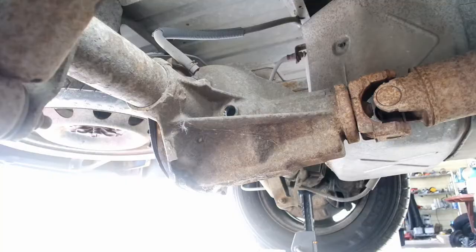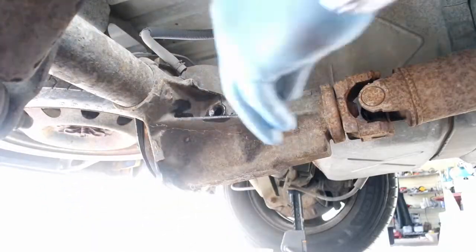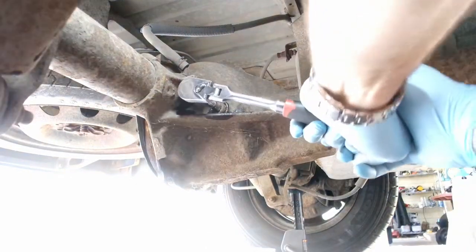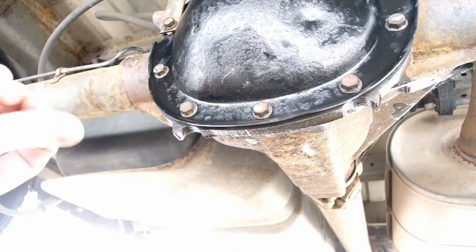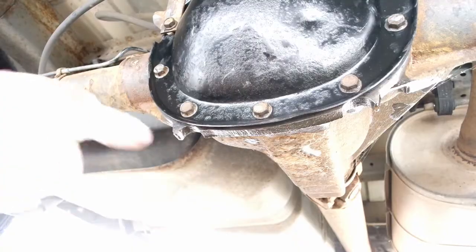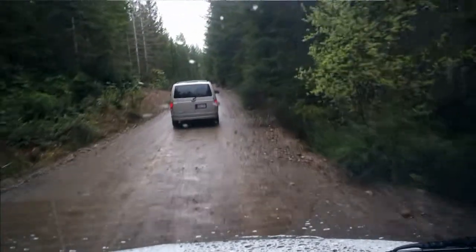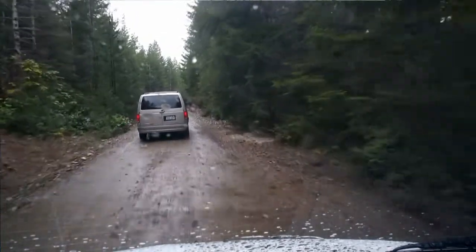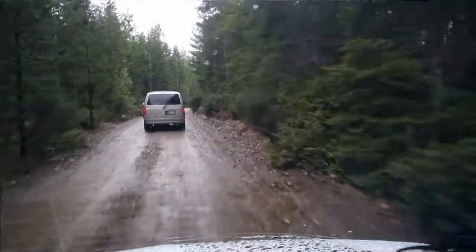To fill up the rear, you will have enough access to only use the squeeze tip and the bottle. Fill until fluid leaks out, then replace the fill plug. The fill plug also seals on tapered threads, so just snug it up until it does not leak. Check for any leaks from the rear differential and do a function check. I hope you use this information to maintain your van to its highest potential. If this was helpful please like and subscribe, and if there's anything you'd like to see please comment below.